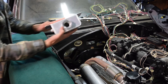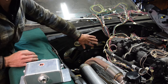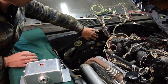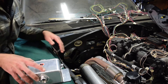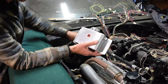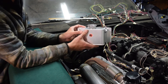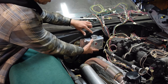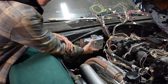A couple of things I have to do: I'm going to drill some mounting holes in here, I've got to grind down flush a few things on the firewall — that'll probably be the first thing I do. Grind that flat, hammer this down, make sure I can create a good mounting point here. Then we'll drill some holes in the surge tank on the brackets it came with, line those up on the firewall, do some nutserts there, and then we'll be able to mount this. One thing I may have to do is clearance this body panel a little bit if I'm mounting it flush.